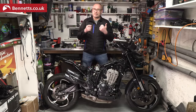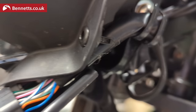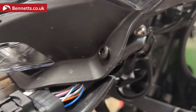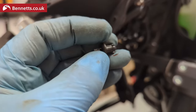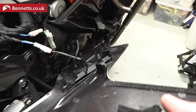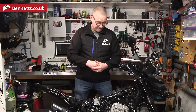There are quite a few push pin fasteners but they work fine. You push the centre in — which seems weird — but that pushes the pin to the back. You want something that won't scratch the plastic and just slip under the clip. Sometimes you get the V under it and the pin just pulls out. To put it back you push it through and insert it, and when you push the pin in you see it splays out. The ABS plastic seemed quite resilient — I've had Japanese bikes in the past that appeared more brittle than this when taking panels off.